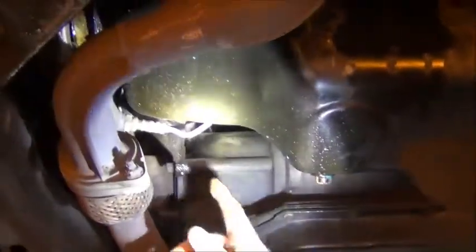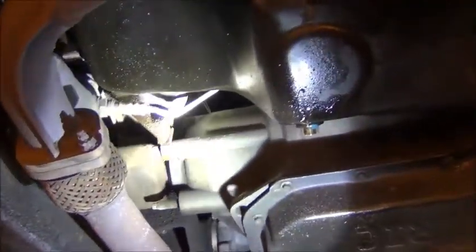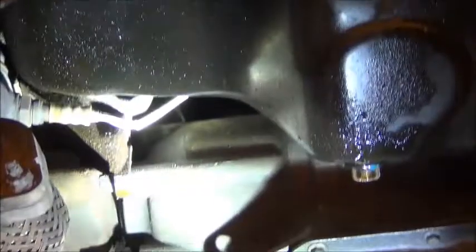As you can see from the bottom of the vehicle, there's obviously some fresh oil dripping in a few areas. This is the engine starter here, this is the oil pan, and there's also a sign of coolant over here — that's a green color. The way we tell the fluid is by the color: we compare it to the dipstick. In this case, this is pretty much obviously engine oil based on the color. Transmission fluid is red, engine oil is brown, coolant is green — that's the telltale.